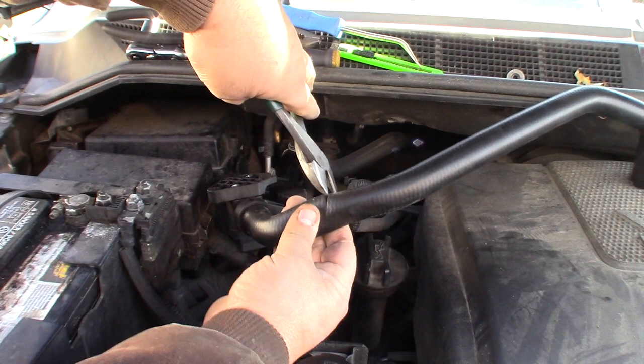Well, the hole appears to be bigger in this aftermarket part. It's not gonna stay. Oh well. That's fine. Okay. So now I guess I'm ready to start her up. See if we have any heat. I mean, the coolant doesn't appear to be excessively low. Let me see here. I can see coolant down in there. Yeah, it doesn't appear to be excessively low. So we're gonna see if she circulates now. Let's hope she does, or we've got other problems. This has a front and a rear heater core, so I would doubt that they'd both be plugged up.